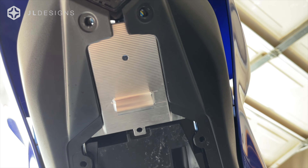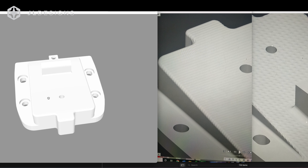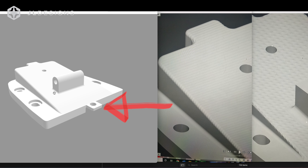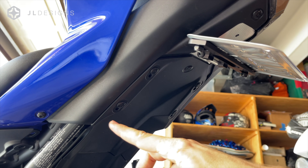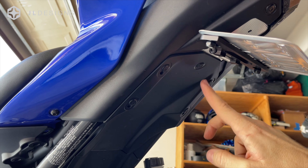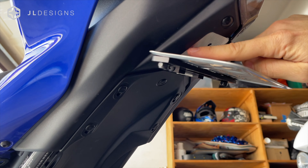We're dealing with three fairings that overlap or butt up to it. This is the mounting — four mounting holes to the subframe. And we have this lower tab here that retains a mounting position for the stock undertail. Here's an image of the stock undertail mounting with all five push rivets and that one mounting to our bracket just to keep it snug and a tight fit.